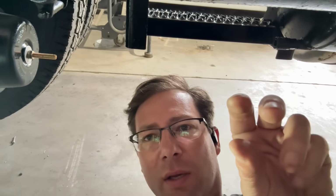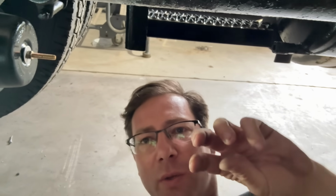I've got both of the brakes caged. It was a bit of a challenge because there were dirt daubers in there, so I had to dig mud out and try to get it loosened up so I can get this caging bolt to stick. It goes in, twist a quarter of a turn, and then you expect it to come out just a tiny bit. That lets you know that it's in the detents or the grooves.